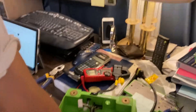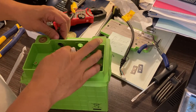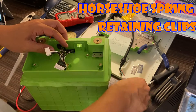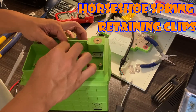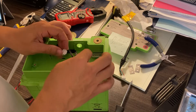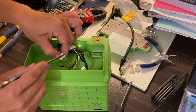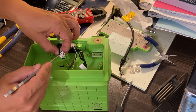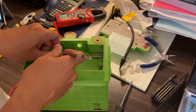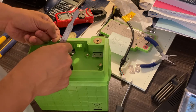Here's something — it's probably a little trivial but you may come across it. So when you have these harnesses, they're held in by these clamps. I don't have my clamps so I just kind of pried it out. You're going to come across these harnesses, and how you take them out is — there's going to be a clasp on one side, and you'll see these little white fingers. You just pry the fingers up and you can pull these things out pretty easily. I'm prying this first finger out and pulling out the large black lead.